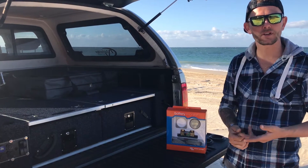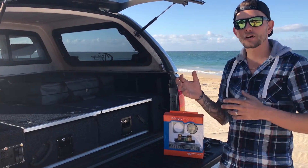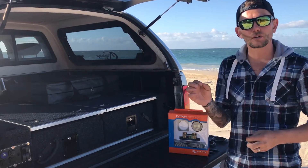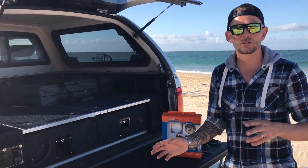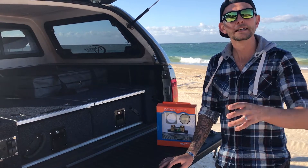It tells you basically what voltage your battery is actually at. So if you find out from someone that knows what they're talking about, you'll know that obviously your battery is going to be flat at somewhere around about 11.4, 11.2 volts — it's going to be pretty much dead flat, so you don't want it to get that low.